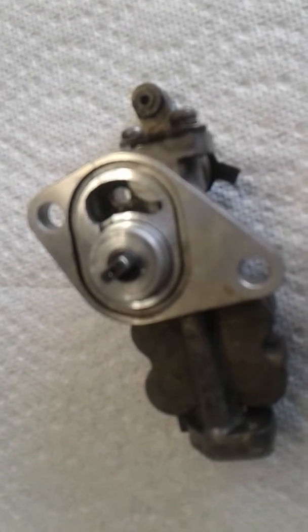We're going to get a little better view of the side of the block in a second here. This is an awful hard position, but here we go. Now, as you can see on the side of the block there, there's a slot in here for a screwdriver. That's the drive that runs — that turns the pump. And alongside here, this little hole here is called an oil slinger.